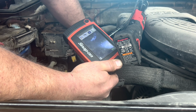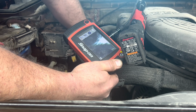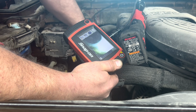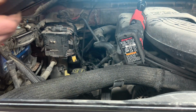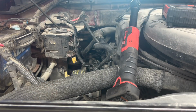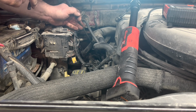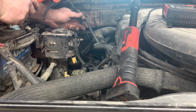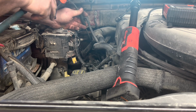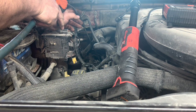Now we're going to blow some air down in that hole and blow all that junk out that's now sitting on top of the piston. And after we do that for a while, then we'll blow it out with carb cleaner or brake clean, whatever. Now I made a deal out of a piece of brake line, 1/4 inch. You want it to be as big as you can get and still leave room around it to get down in the hole, leave room for the debris to get out around it, so that the wind can swirl around and blow.